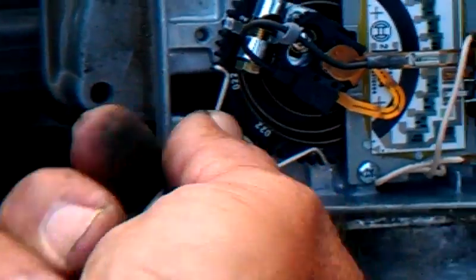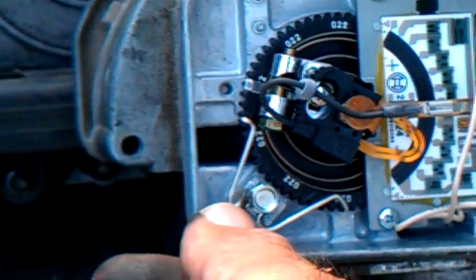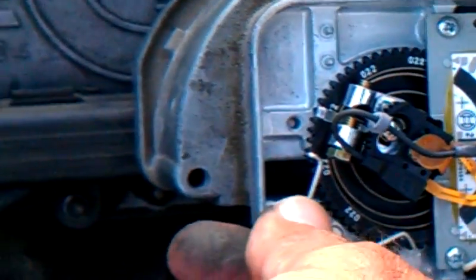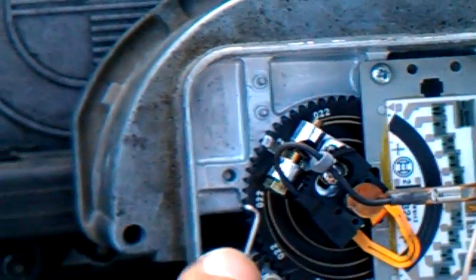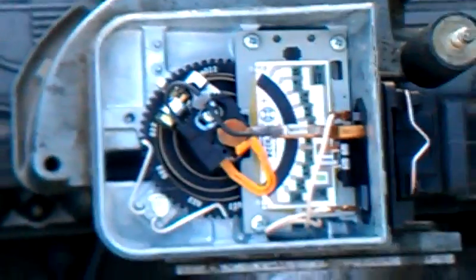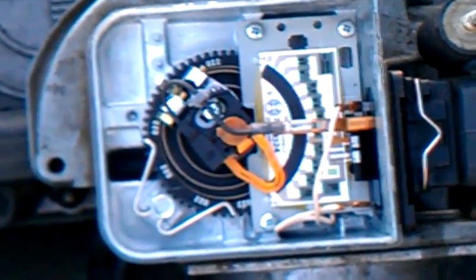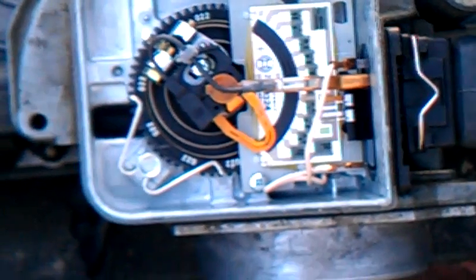Here's another one. If you go clockwise, then what you are doing is you are making the mixture leaner. Most of these cars fail in California and other states because of high HC, and that is because they are just lean — just horribly lean — and that's never good.